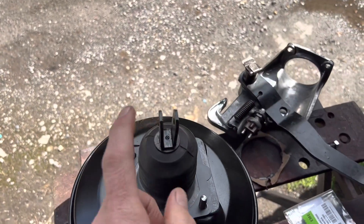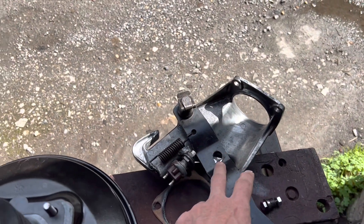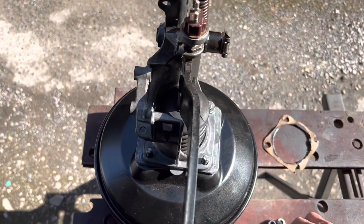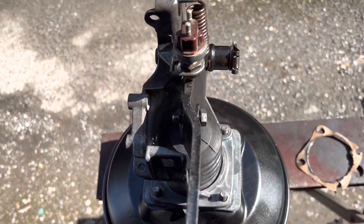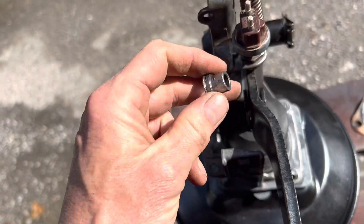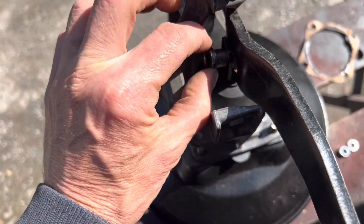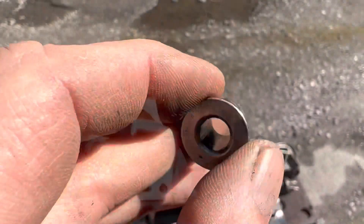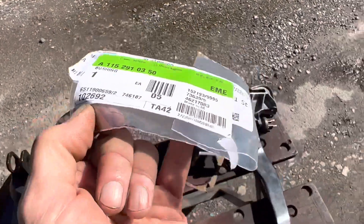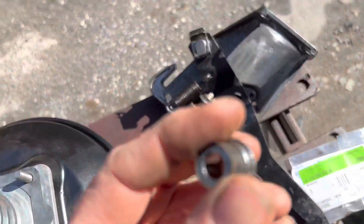Before I put this back on the car I just want to show you how this attaches to the brake pedal mechanism, because there's a variety of different ways that these brake boosters attach to the brake pedal, and if you don't know how they attach you might struggle to get it off in the first place. The brake pedal is held onto the brake booster via a bolt, but if you just take that bolt out and the nut off you still won't be able to get the brake pedal off, because there's this fitting that goes through the hole and stops you. You have to get a flat blade screwdriver under there and pull that fitting out before you can lift the brake pedal off. This fitting's part number is 115-291-0350, and on this particular style of pedal you have a plastic bushing which sits inside there and goes over the metal piece.